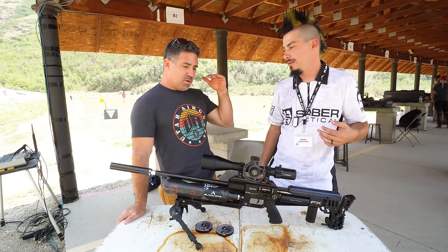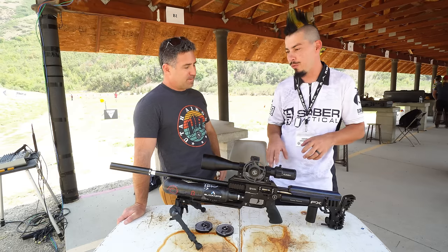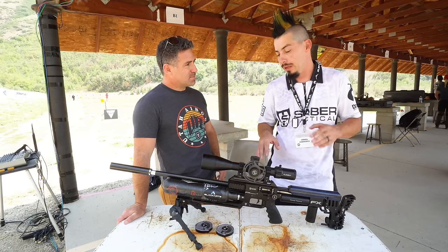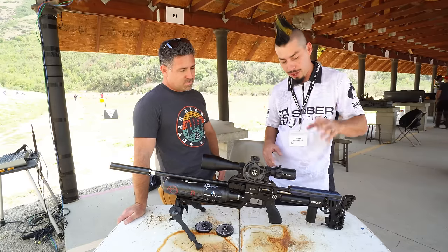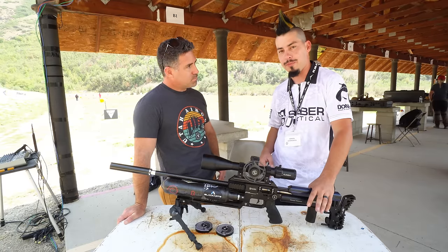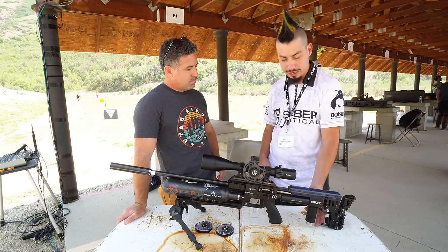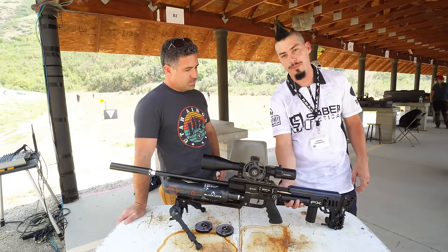You get that flow linear, things happen quicker. Exactly. And cleaner. You don't get more fuel on one side than the other. So we only got one cylinder here, but the flow does make a difference. No bottlenecking. I'm running at 112 bar on the regulated. I got the segment gauges here. I do have an external plenum as well on top of the power plenum.